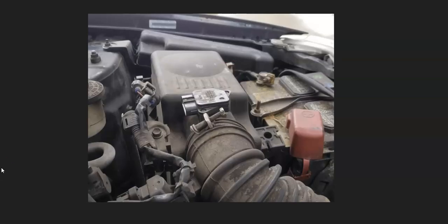The next thing to check is the mass airflow sensor, which will be located up around the air intake. This basically detects all the air that goes into the engine. Usually if there's a problem with the mass airflow sensor, you're going to get another code, like a P0102 or something like that. So if you are getting other codes, be sure to pay attention to that. I made some videos on testing the MAF sensor — I'll put a link down below.